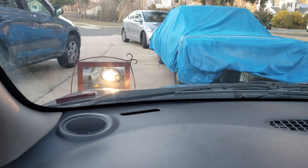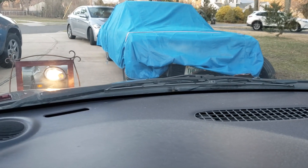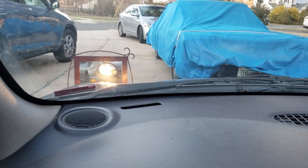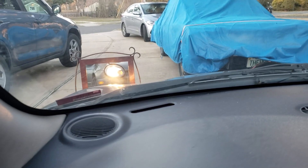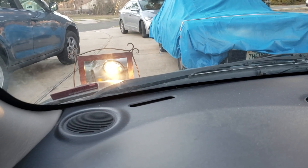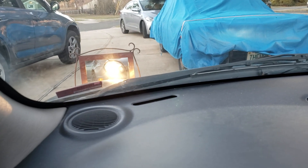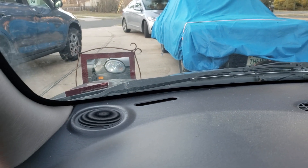Nice, simple, fast little trick. At nighttime you could just watch it as it glares off the cars, or have somebody stand next to you. Turn on your headlights, turn the key — if it stays bright, you have a starter problem; if it dims out, you have a battery problem or a bad connection.